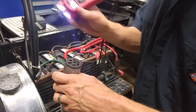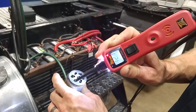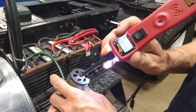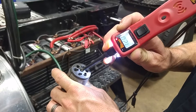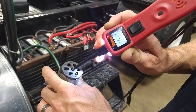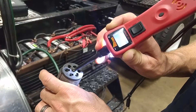Going to the marker lights and clearance lights for the trailer — that's a constant 12.1 volts. The middle one in auxiliary is a reverse light. Currently we do not have reverse lights; we're going to have to start the truck and put it in reverse. The truck is started and the gear is in reverse — you hear the beeping noise. Good, take it out of reverse and the light goes out.